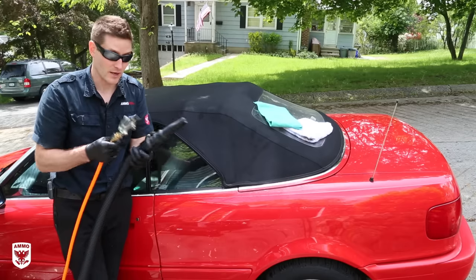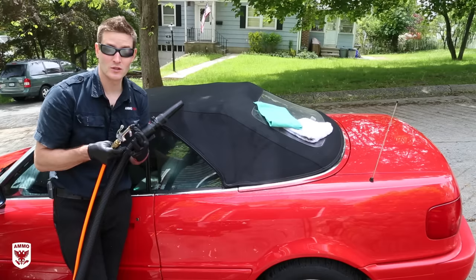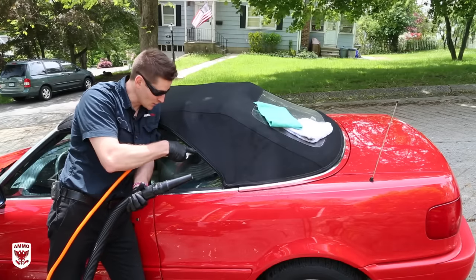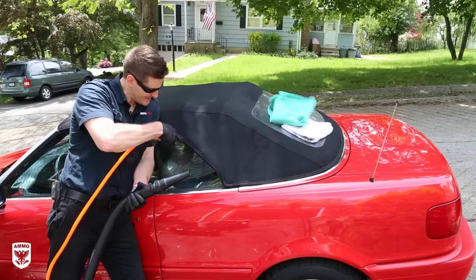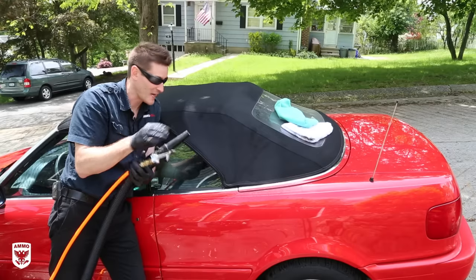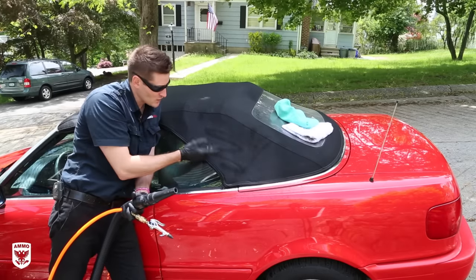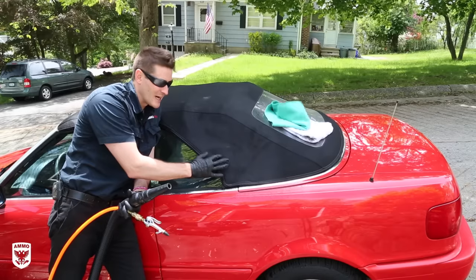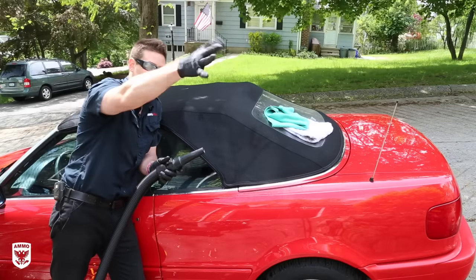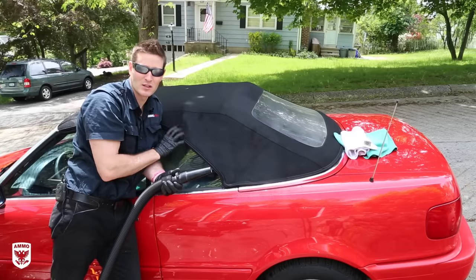What I like to use is air. We have two things: compressed air and the Master Blaster. Two very good tools but for two different uses. If you use compressed air, it's pointy — there's a tip here — so I like to use it on the actual threads to get into those tight areas. Think of it as a sniper rifle versus a bazooka. If I use compressed air on the main surface area, it's going to make little lines, and eventually when it dries you'll see very faint lines — not good. So I use the compressed air just for the edges. Then I use the Master Blaster, which has a nice wide stream with heat, and it blows off all the extra water. Of course you can let it air dry outside too, but I like to use this.